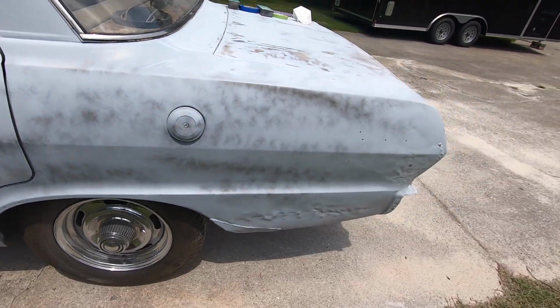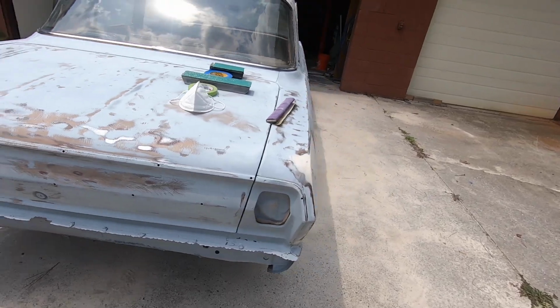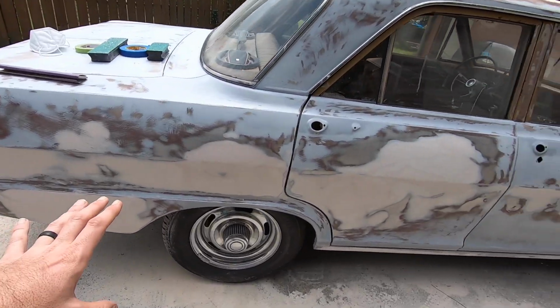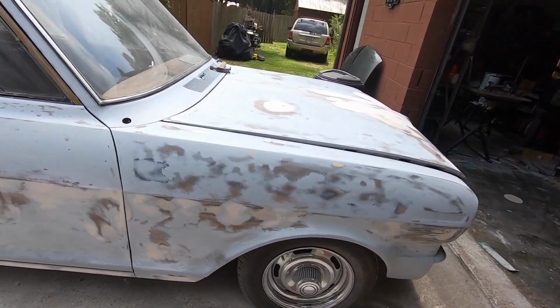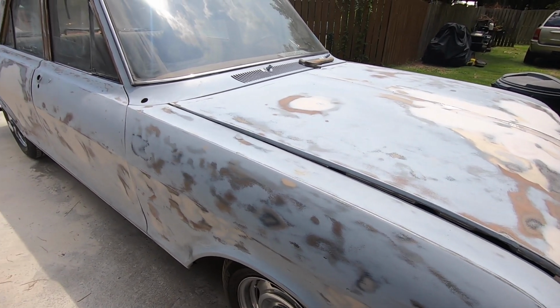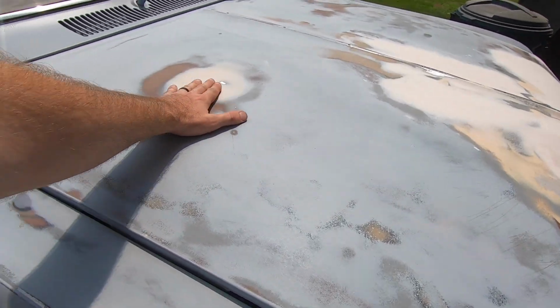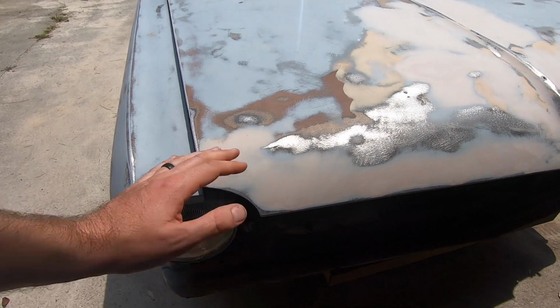What we have done on the other side, as we come around, is we've corrected and fixed all of those type issues with this side. How do we do that? We sanded it down. We blocked it with a stick and 80 grit paper to see where these bad problems exist. And as we saw them, we started correcting them with filler, right? So Bondo.